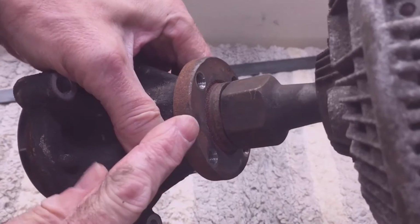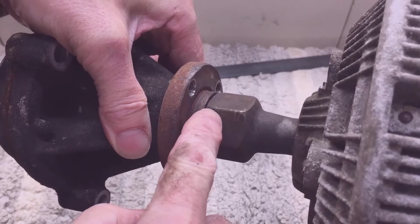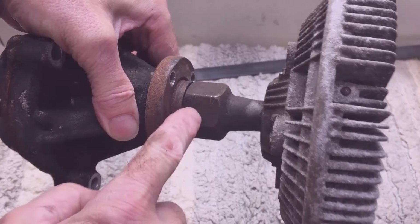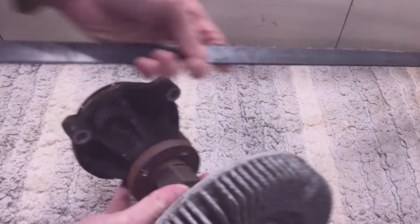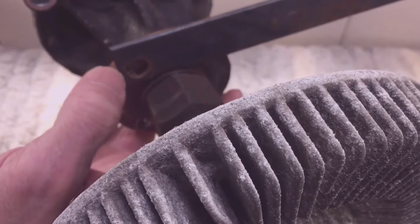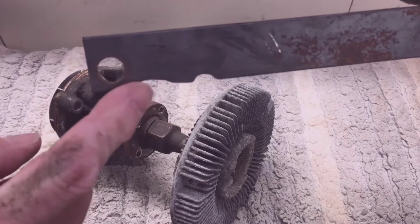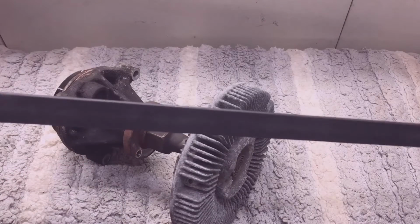And remember, this has the pulley on it, so it's sticking to here, and you have this, so you have to clear this, but mainly this part of the hex, so you're not pushing against the hex. And then you're inserting onto your bolt head and around this hex. So that's why that notch is necessary, to give you a little more clearance around the hex.